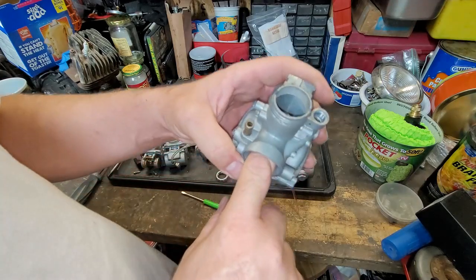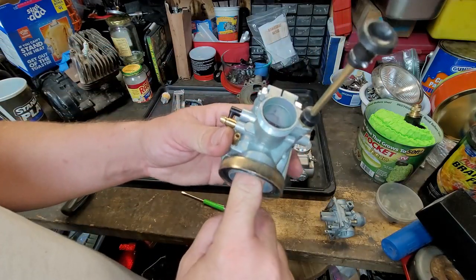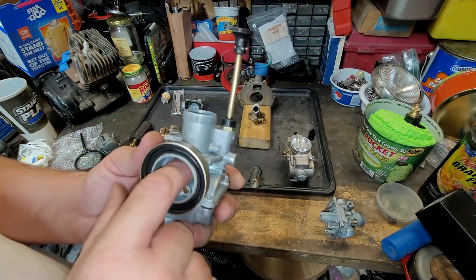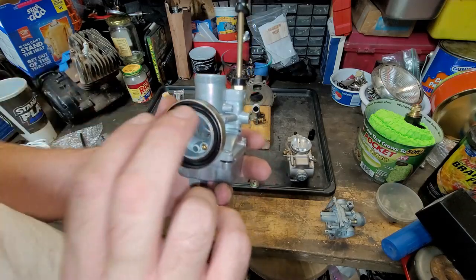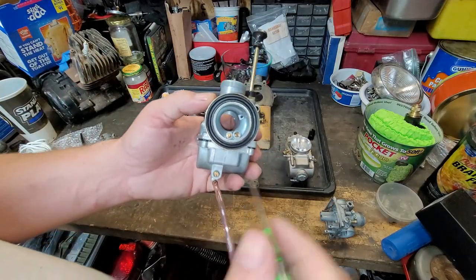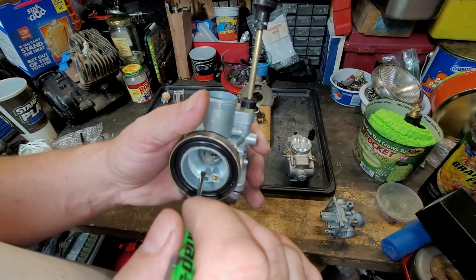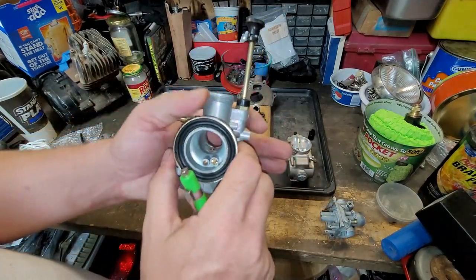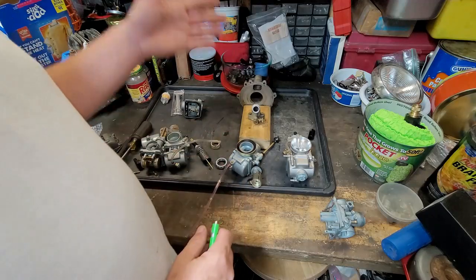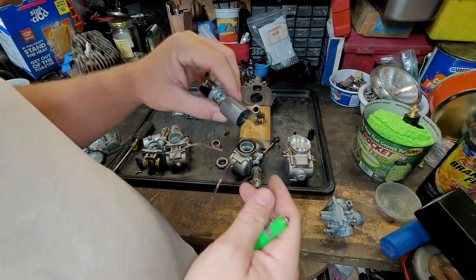Watch this — I can bury my finger almost all the way in this aftermarket one. What does that mean? That means this carburetor is going to flow more CFM — it's going to flow more air through it, which is awesome. Also the venturi side of this — you can see how nice and smooth that wall is, how contoured it is all the way around. More air is going to funnel into the venturi and pick up the fuel from the main jet below. The thin needle is going to give better acceleration and a better top end.